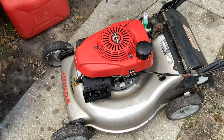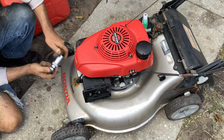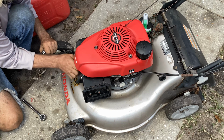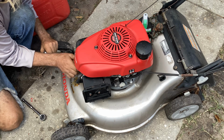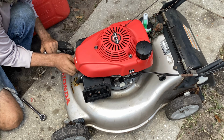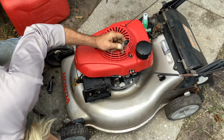We got an NGK plug. I'm going to remove that right now and see, do we have a sporadic plug here? Because that happy juice should have done us good. And it done us bad. Looks like it's running rich.